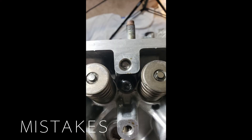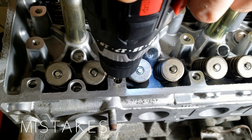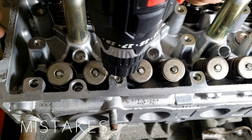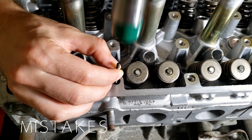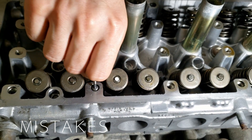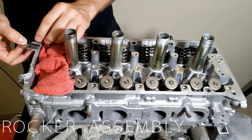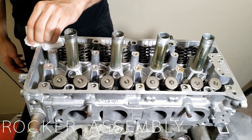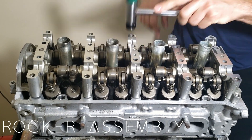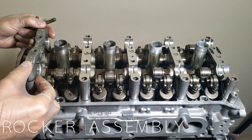I managed to break a bolt right in the cylinder head. I used a bolt extractor, which is a hardened piece of metal with a tapered left-handed thread. You pre-drill a hole and since it's self-tapping it will eventually bottom out — if you're lucky, you'll start unscrewing the broken bolt. Now we need to remove the rocker assembly, clean the dried Honda Bond, and reapply it. I decided to only torque down the cap with the Honda Bond since I have caveman hands.